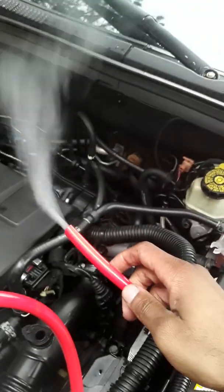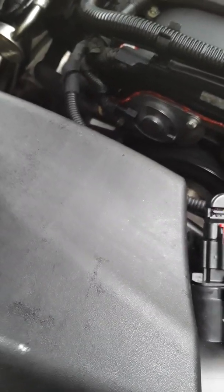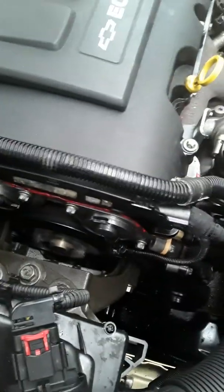YouTube is the best. I just want to reinvent the wheel and give it to you guys — let you try it out. So I'm going to stick this down in here and watch for smoke. This jar is full of smoke. It said I had a mass flow code. The other day it said I had a leak, and there's the sensor and a code for the crankshaft sensor. This Chevy Cruze keeps giving me all kind of codes. But as you can see, this is the mass flow air sensor here — there's no leakage, no smoke coming out anywhere. I don't see anything. So I'm assuming all my seals are fine.